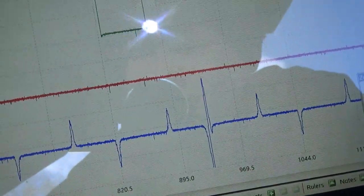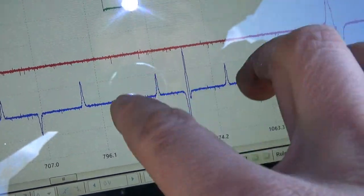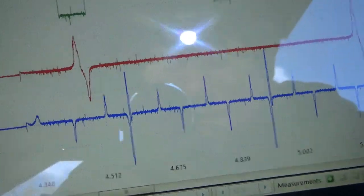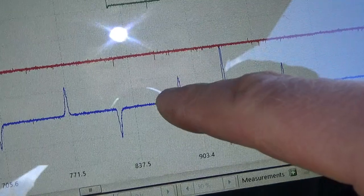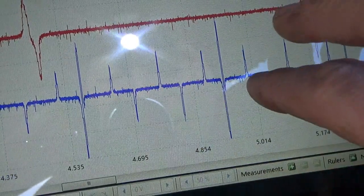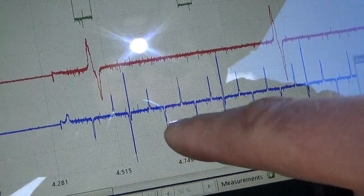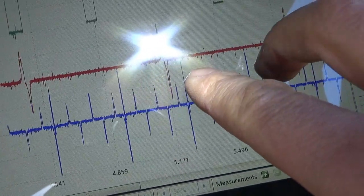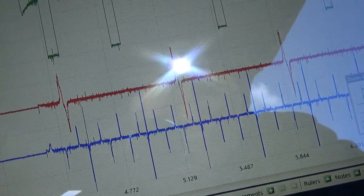We'll have to look at service info to see what this should look like. It goes down and up here, but here we only have up and then down and then up and down — ba-boom. I would assume it would just be like all these other pulses. The injectors are firing — I'm curious to put a probe on an ignition coil and see if we have spark.